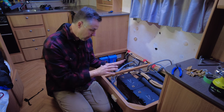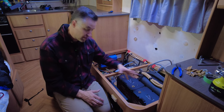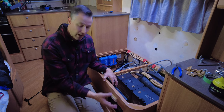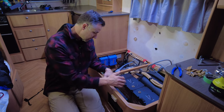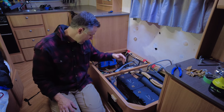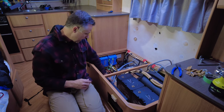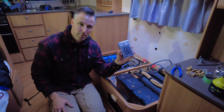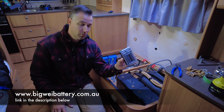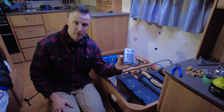After a bit of mucking around working out where the batteries are going to fit, the best use of space is the 200 amp hour batteries against the wheel arch and the 2000-watt inverter against this wall. There's a vent going on the side here for airflow to the inverter. Between the batteries there's about 100mm gap — plenty of ventilation. I've also got this fuse block from BigWii Battery, only about 20 to 25 bucks. It holds 12 fuses, they all light up when they pop, and it's rated to 100 amps.